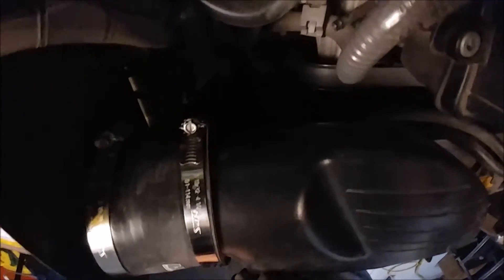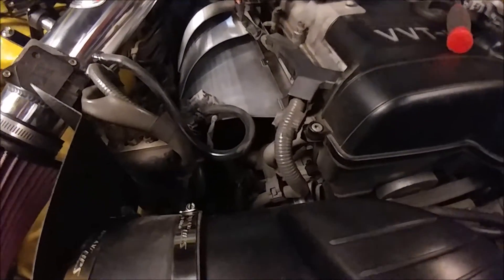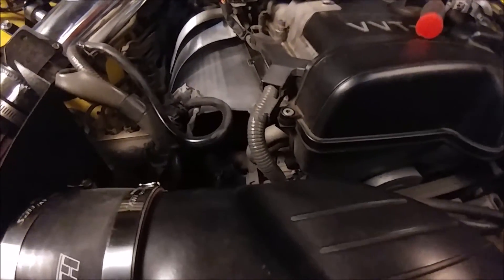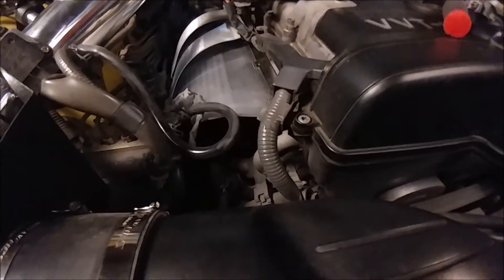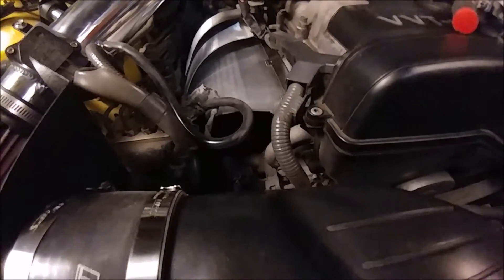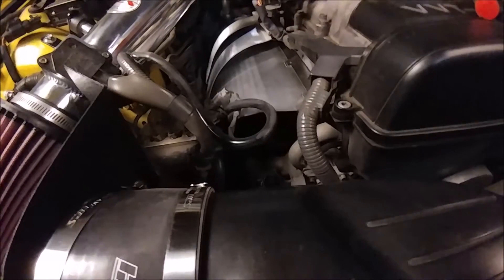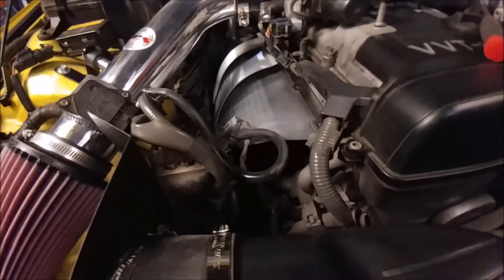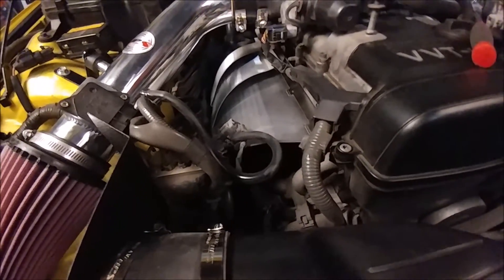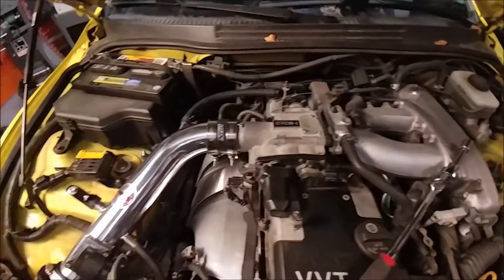You can also see how it kind of seals in this little tunnel. It's an air tunnel that the fan is going to be pushing all the radiator's post-convection or post-heat-transfer air across. Its exit is right down underneath the underpanel. So we're creating a system that's actually taking the heat out of the engine bay and diverting it down to the bottom, as opposed to continuing to heat soak this whole intake plenum.